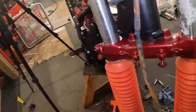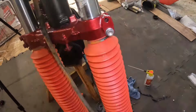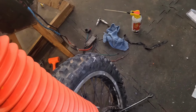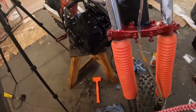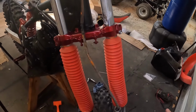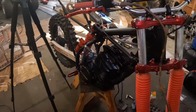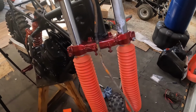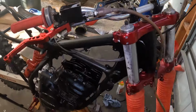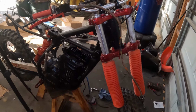But make sure you hold the front brake down all the way, open it, it'll shoot some air out or some liquid, and then close it, and then you can let go. So don't let go until you open and close it. And you basically go until it's a good flow of brake fluid, and you'll have to keep refilling it every now and then. But that's all there is to it. I'll do a little time lapse. Hopefully that'll help too.